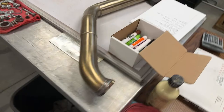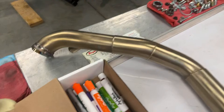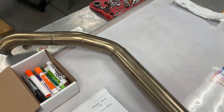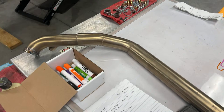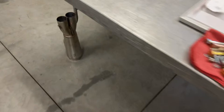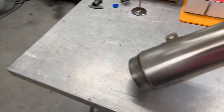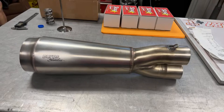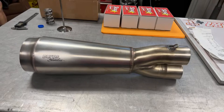Last thing — people asked about the pipe. Here is one of the head pipes. It starts out as a 2-and-an-eighth, then goes to 2-and-a-quarter, then goes to 2-and-three-eighths. This is something that George got Burns to make — it's not like off the shelf. That's the design he came up with. It has a very short collector. Everybody said, 'Why did you make that so short?' He doesn't know — he just decided that's what he wanted to do. There's the megaphone and the two-into-one collector. You can't call Burns and get it because George just made up what he wanted to have.